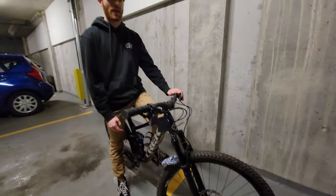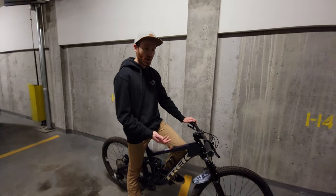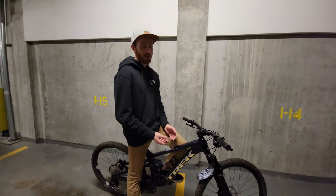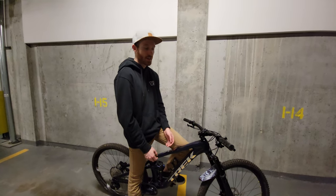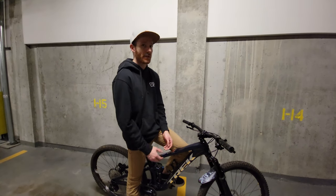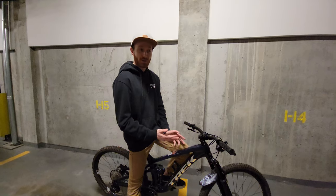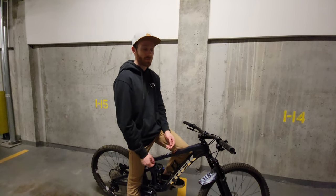This was a mistake. The bike just wants to be ridden really aggressively, and with these tires they just don't have enough volume. You have to run a super high PSI and I was still hitting my rims and getting pinch flats. As soon as spring rolls around and I redo my sealant, I'm going to put the 2.4s that came on the bike on and I think it'll be a little better.